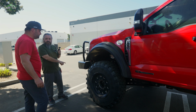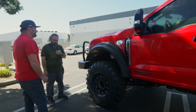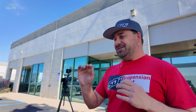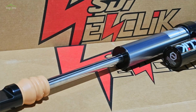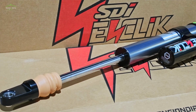What's the suspension travel here? Do you know? I want to say on the front, it is 11 inches. Wow. The shock travel is different. It's actually its own custom shock for this lift. It's not the same as a Carli. It's a little bit shorter of a shock, believe it or not. The heavier you get, the less travel you can do. Right? Exactly. And a leveling kit shock was too short, and like a +4 through Carli or +5.5. There are a lot of little chassis differences. It's not 1-to-1 like on an F-250.